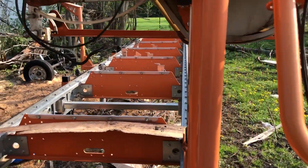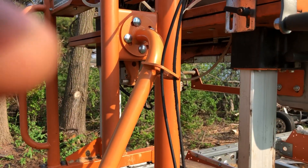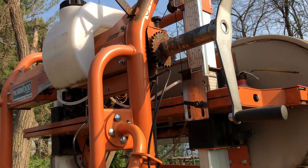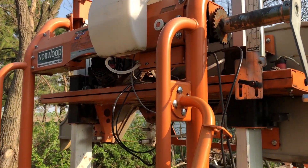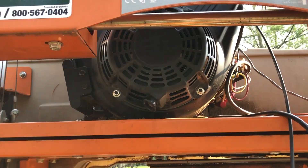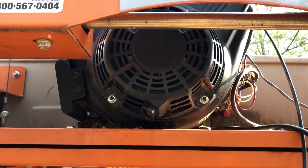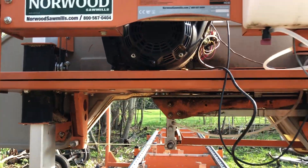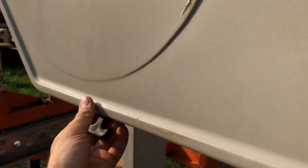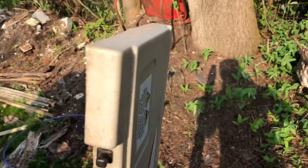As for brakes, I'm actually going to remove the cable brake because the motors have electromagnetic brakes — kind of like an electromagnetic clutch. The whole system is going to run off 24 volts, which is interesting because this motor doesn't have a 24-volt output — I believe it's around 15 volts. The stator may not handle the amperage we'll be drawing, so I might have to mount an alternator. I'll show you where — pulling the case off here, you can see the clutch and the main drive pulley.